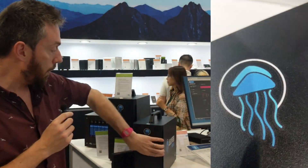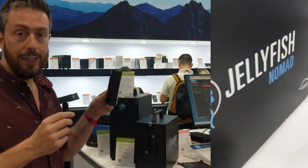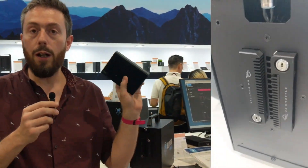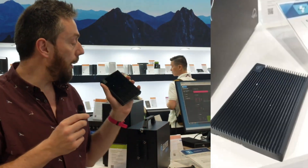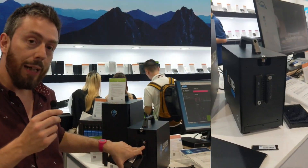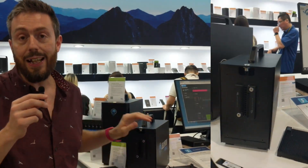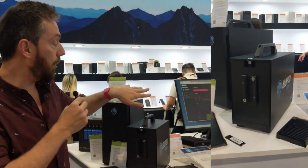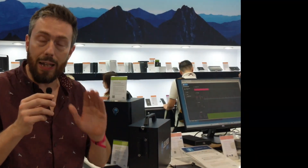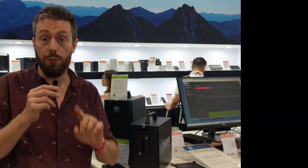It is populated with two insertable modules. Each one of these modules contains four M.2 NVMEs. Those M.2 NVMEs are in a JBOD configuration, and then you slot them in here. There's a locking mechanic which allows you to install up to eight M.2 NVMEs inside. The system has software-managed RAID internally and also utilizes a special file system internally to make sure that redundancy is taken care of too.